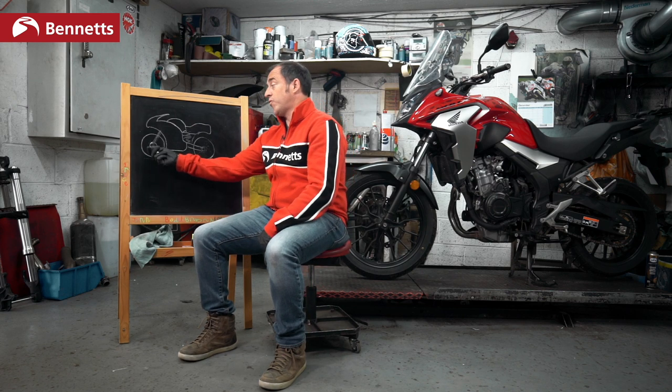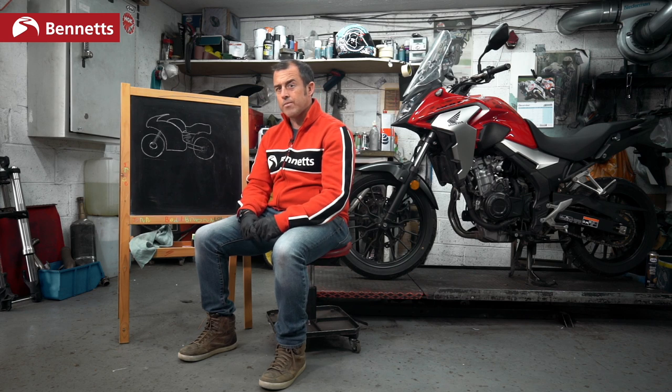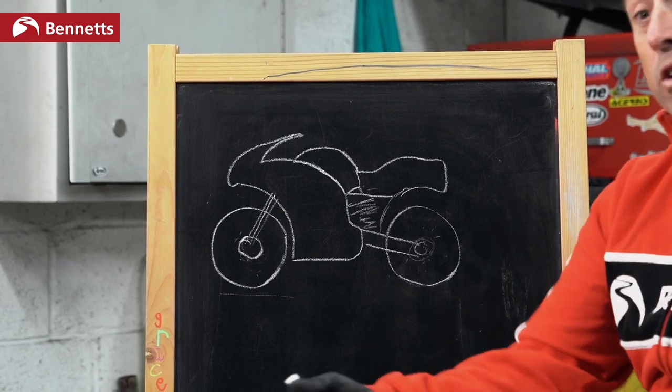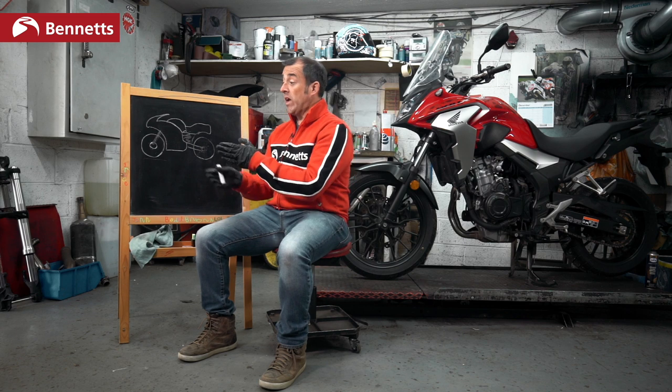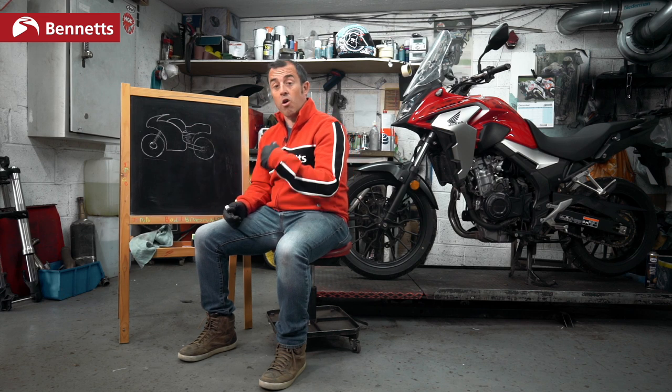The other scenario: the front wheel is doing 50 miles an hour, the rear wheel is doing 60 miles an hour. The throttle is constant, the gear is fifth or sixth, and the rpm is quite low. So if the rear wheel momentarily spins, we know he must have hit a white line or a patch of grease — because it was a slight spin. We know from the IMU we have no lean angle, so the intervention doesn't need to be as abrupt or as quick.